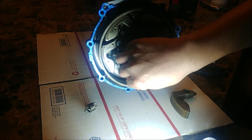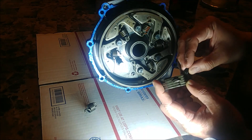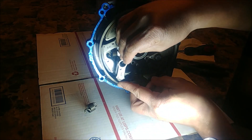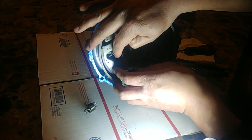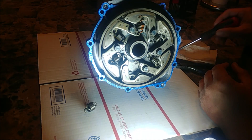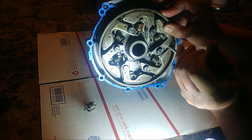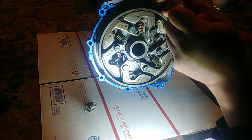Let me install this rubber here. I have to put it in the shoe to get it on there. This one's been oiled — they're all oiled. Somebody else did a take on these and did them dry, so they have a lot less friction when they're oiled. Somebody had a concern that these rubbers would prevent the shoe from retracting, and as you can see, the shoe fully retracts even with those rubbers in place. So that's not an issue.